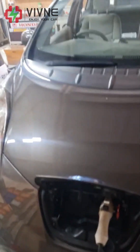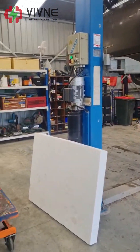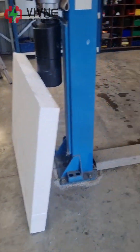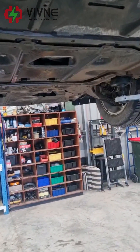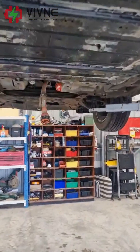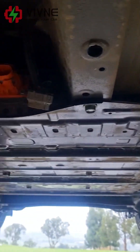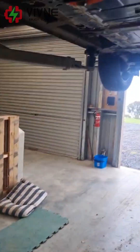So let's take it for a run. We got the Leaf disconnected — 12-volt battery removed, took the main fuse out inside. There's our trolley with a pulley setup. We're going to start taking the plastic off and then keep going after that. We got the bottom cover off. I got the plugs off without breaking anything because I went with the instructions. Now we're slowly undoing a few nuts and then we put the battery on the pallet with the pulley setup.